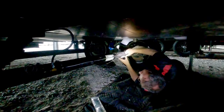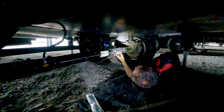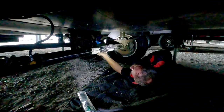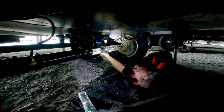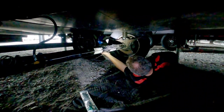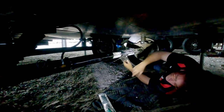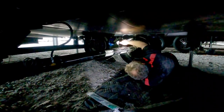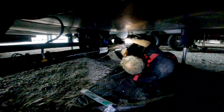Some people ask: why run the brake lines to the back of the axle instead of the top? They tend to have the least opportunity for flying debris to hit them. If you look at a used axle, you can actually tell which side faced front by the wear marks in the paint from flying debris. If you have lines across the top and hit a big tree limb or piece of broken tire, it could wrap around the axle and cause damage. On the back, there's less chance of impact.